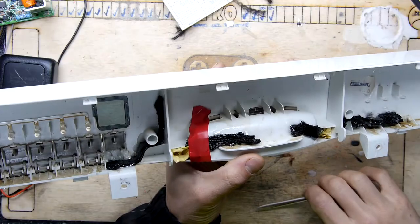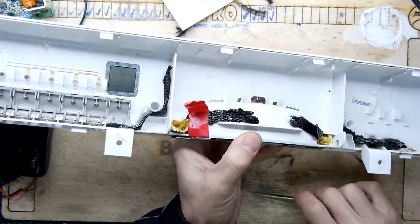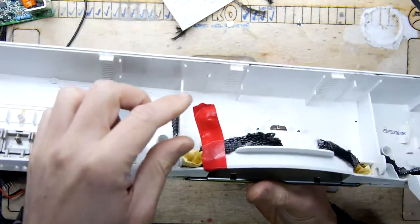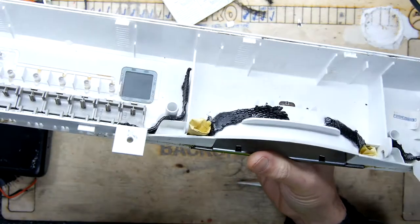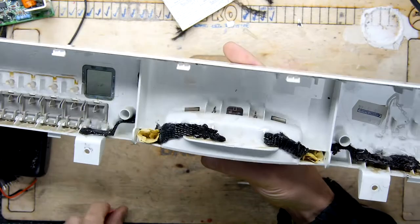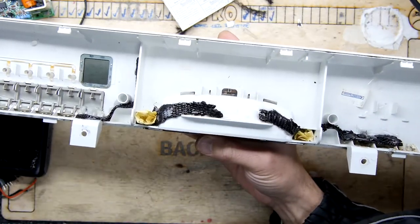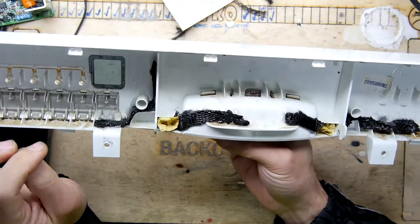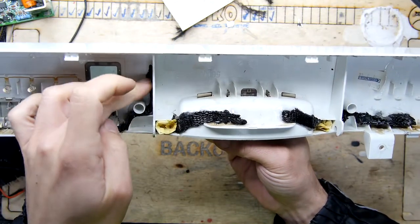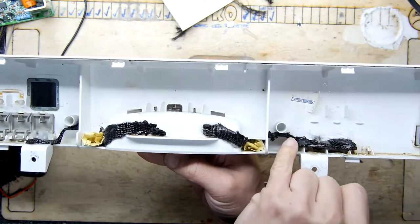So good. Pulling off the tape. Now, some of you might not believe me about the efficacy of using insulation tape with resin, but check this out. Ready? Shbloop. Comes straight off, and you just get a nice smooth finish underneath. So all that remains now is I'm going to mix a batch of the fiberglass impregnated resin, the stronger, tougher resin I've got. It's still a quick cure, because I just want to pour some in behind here.